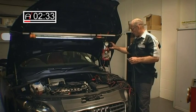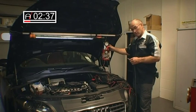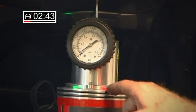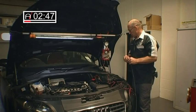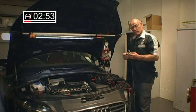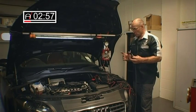Back to the machine. We have a light oil in a chamber that has an electrically heated element driven by battery power. It's a timed-out heater, so eventually the heater will trip out and you can re-engage it any time at all. That provides a fine powder smoke under a small pressure — about 0.5 psi. It's not a high pressure.